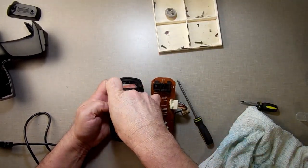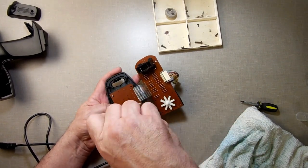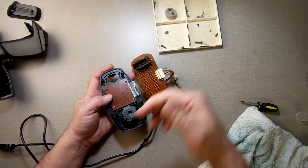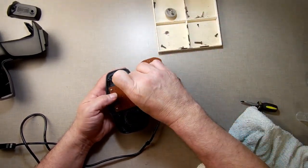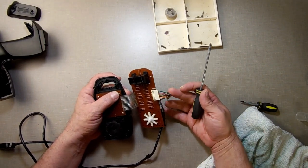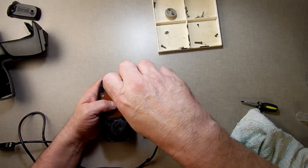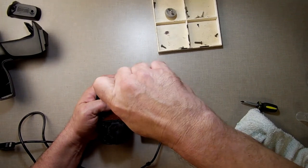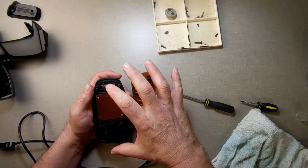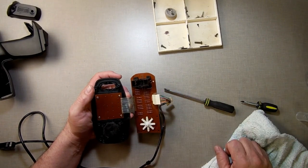Yeah, the ColecoVision controllers are pretty interesting in their design and how they use these diodes. What a diode does is it controls current flow. The current can only go one direction. So I believe the ColecoVision has two power lines coming in, and it uses these diodes and those two power lines to encode buttons on, I believe, four going back out.